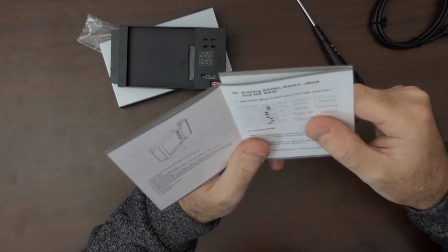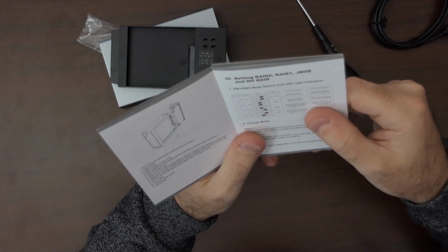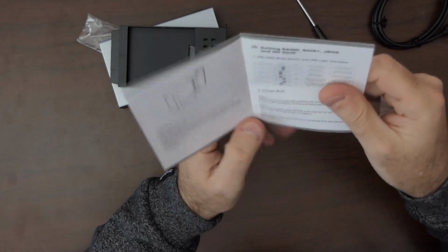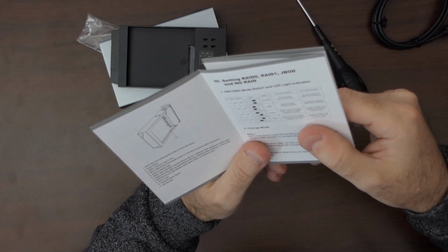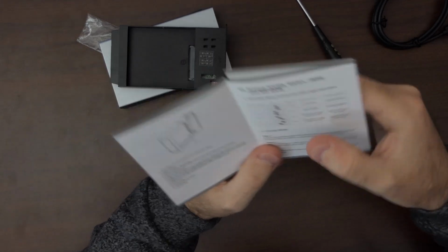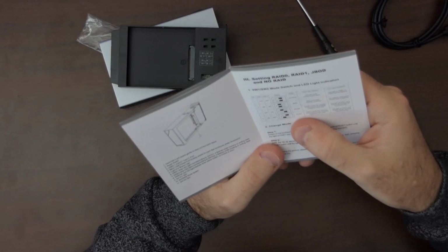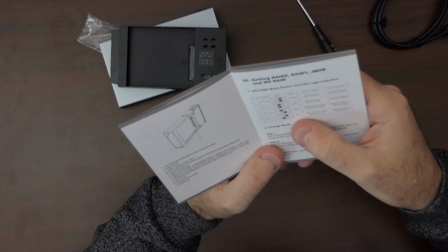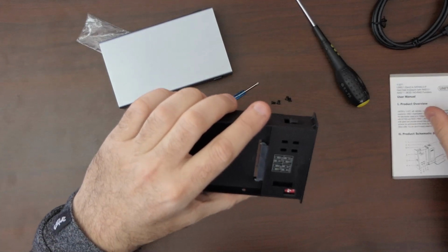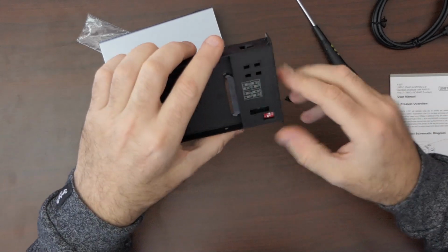Okay. All right. Cool. I seem to recall another technology which uses, I think they call it 0 RAID or something like that. So yeah. All right. No RAID. No dash RAID. The way they wrote it was almost as if it's like an acronym for something. Oh well. Let's have a look at this. Okay, no RAID, JBOD, RAID 0 and RAID 1. We are going to set 1 off and 2 on so that we can get this thing set up in RAID 0. So, done.